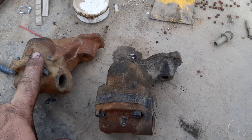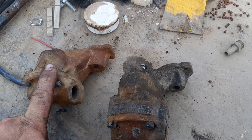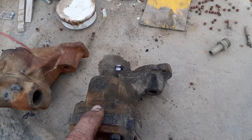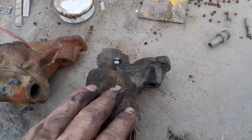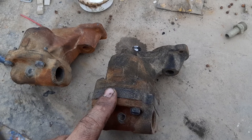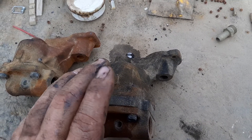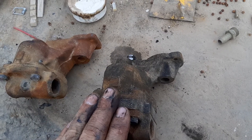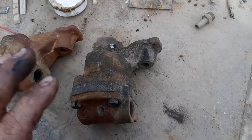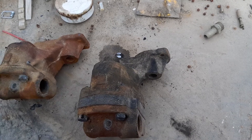If you've got an early block and you're doing a build on it — even if it's non-turbo or whatever — put a late model pump out of like a '99 or 2000 6.5. It could be a van, a truck, doesn't matter — they use the same oil pumps. Then just put your old model pan on it. Almost all the pans are the same — I'm not going to say all of them because I could be wrong on that, but nearly every single one I've seen has been the same. Take your pickup tube, put your pickup on the new one, and you've got a high volume oil pump with just having a standard oil pump.